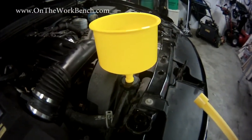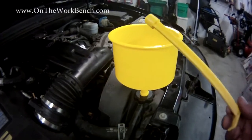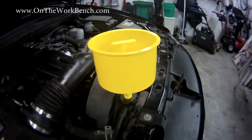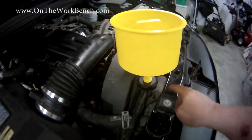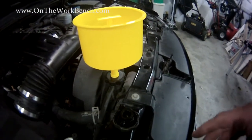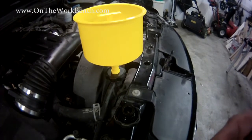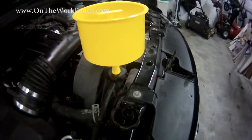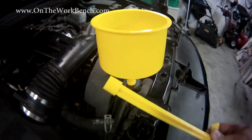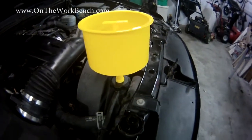If I need to do a purge of the radiator, I can run the vehicle and all the coolant will back up into the funnel. When done, to minimize leaks, I take the plunger, put it back in, remove the assembly, take a paper towel and wipe it out, then remove the cap. There might be a little residual coolant — let the engine cool so everything can get back into the storage tank. I'm just showing how the funnel keeps leaks out. I really like the plunger for sealing it up when removing, so nothing leaks onto yourself or the floor — just minimizing spills and making sure your repair is done correctly.